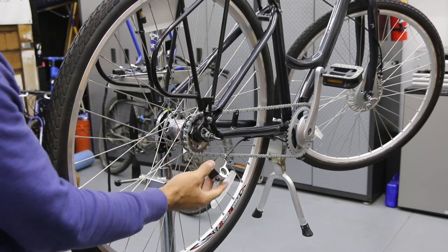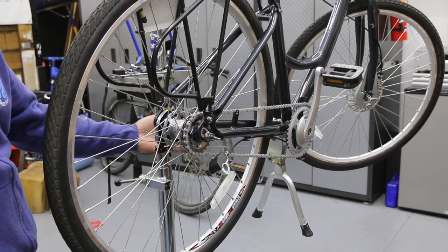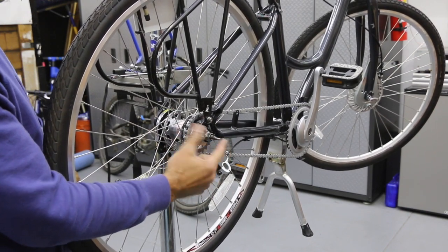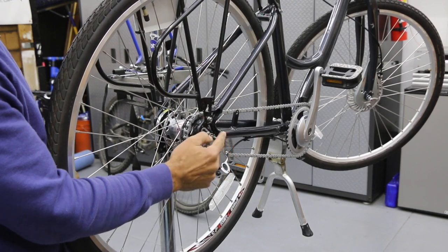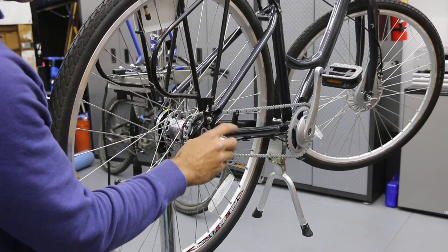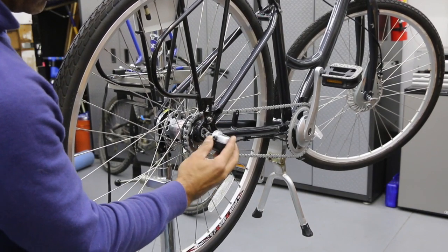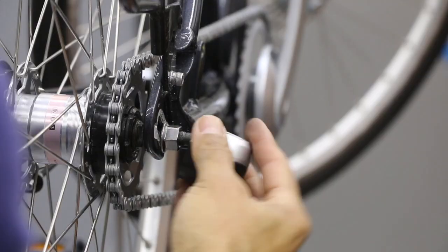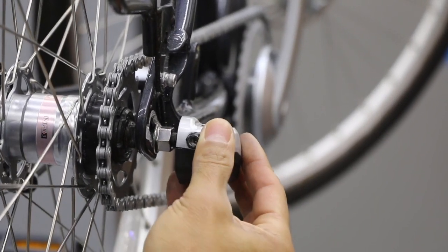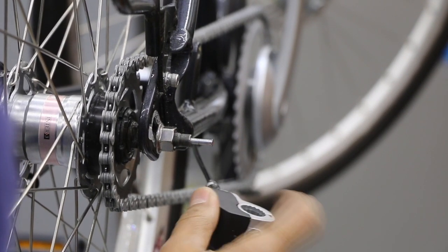Good. We still have our shifter to mount back onto the bolt. Then we have our coaster bolt to connect. So we're going to do this one next. Make sure your little spring is still in place. Remember, this guy can come out all the way. And we're going to be able to see the little window sitting on top, which is the 12 o'clock position. And it needs to go sit directly on there. This guy's going to come sit. Might have to kind of finagle a little bit. So that pin needs to go right into a small little slot on the inside.